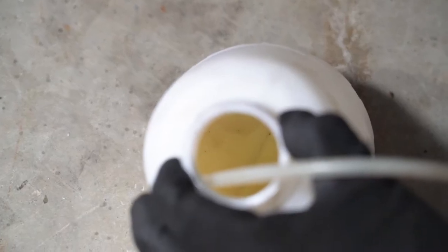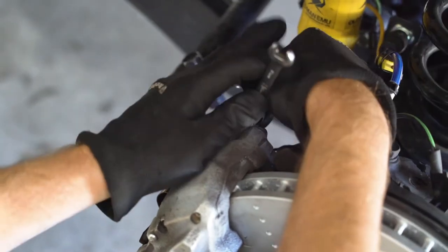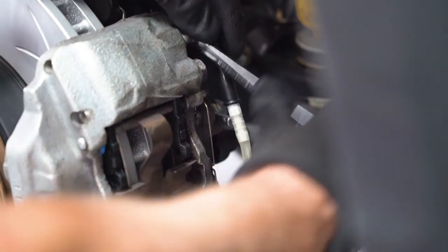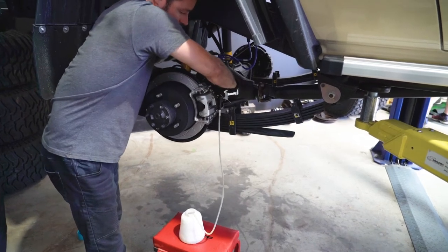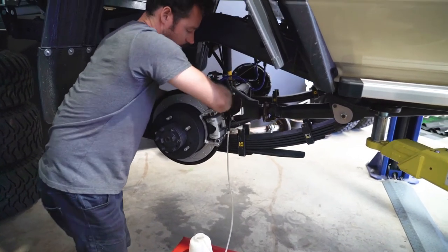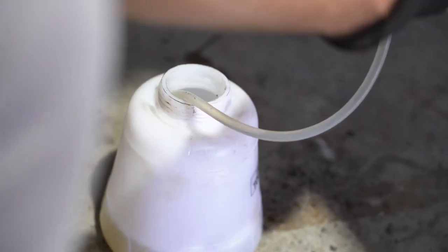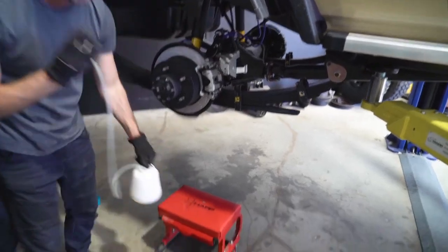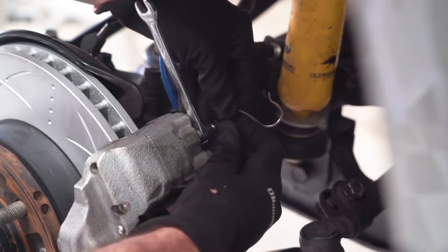As they pump the brakes, top up the Brake Master Cylinder with fresh brake fluid. Look at the bleed hose and watch for air bubbles. Once fresh brake fluid has flushed through the hose and air bubbles have stopped appearing, close the bleed nipple, ask your assistant to hold pressure on the brake pedal, crack the nipple and allow the fluid to drain into the bottle, then close the nipple. This will need to be repeated until all the air is 100% bled through. Pro tip: always make sure your brake fluid bleeder bottle has fluid covering the bleed line at the bottom of the bottle to prevent air being accidentally drawn back up into the caliper. Move on to the next furthest corner until you get to the driver's side front.